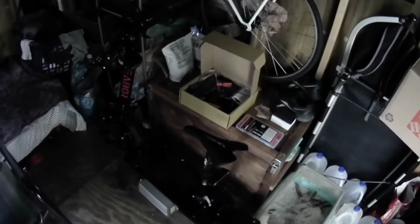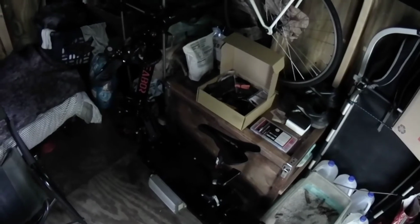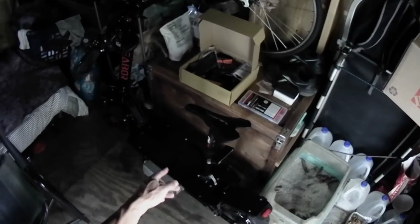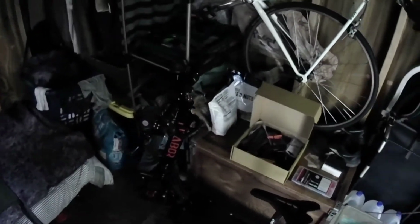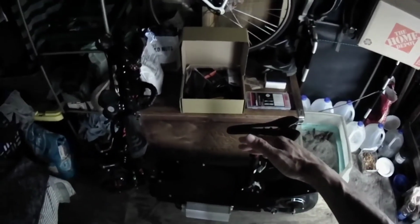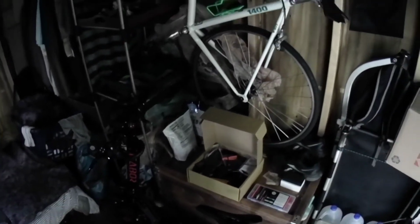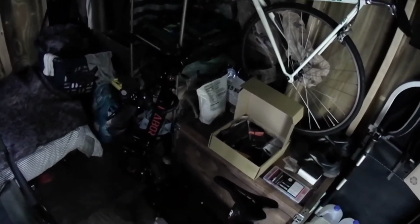So that's good to know. The battery is underpowered. I was a little suspicious because when I opened up the deck to see the size of the battery, the width, especially the width, wasn't big enough, and that worried me, because that determines amperage, your output discharge amperage, and amp hours.